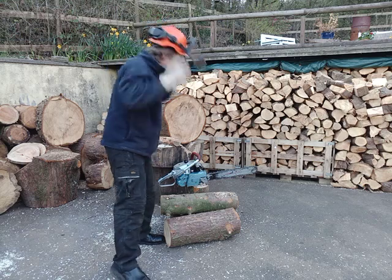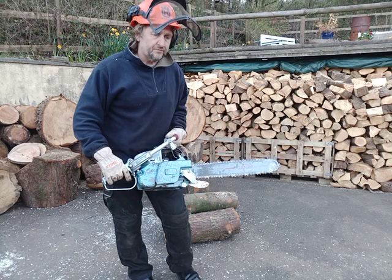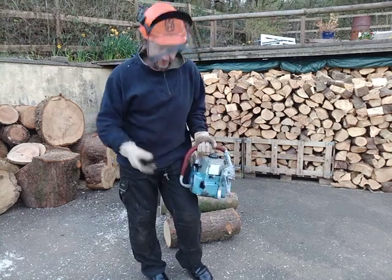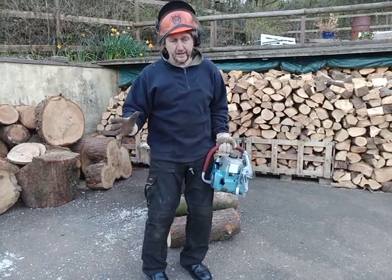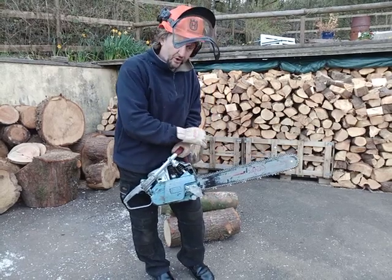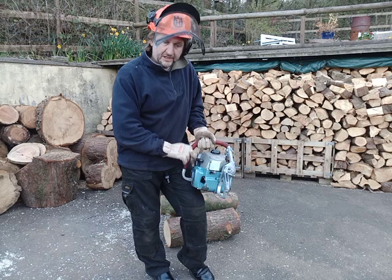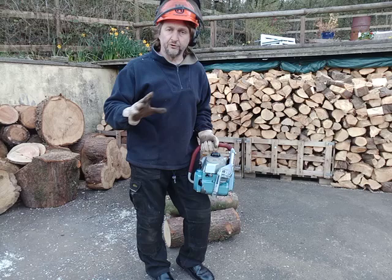And genuinely, as a side as well, because you see a few of these coming up for sale, and they are often plagued with a number of little issues. They're devils for having coil problems. So this was in really excellent condition, although you can hardly tell. It looked lovely and clean, but could have just been cleaned up. So it had a replacement coil, which is obviously working really, really well. And so they're devils for having intermittent coils, and the tank vent is also a devil for starving fuel.